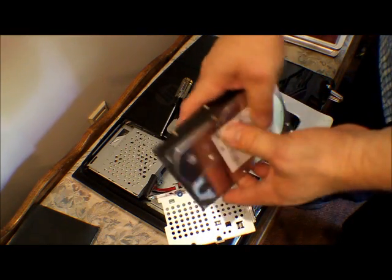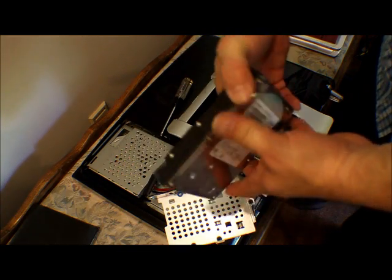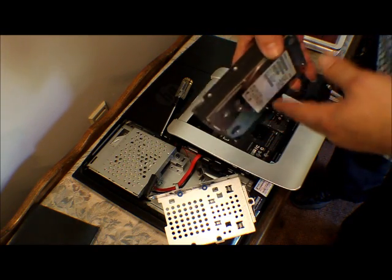All you do is go in reverse. It's a SATA hard drive — it's got the SATA plugs on it. Go to the store, buy the same kind of hard drive, pop it in there, pop in your restore CDs. Hopefully you made them or you purchased them, and you're up and running again.